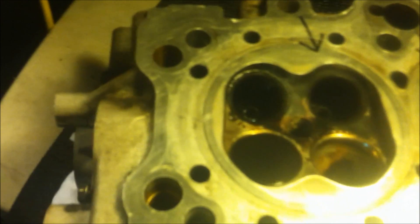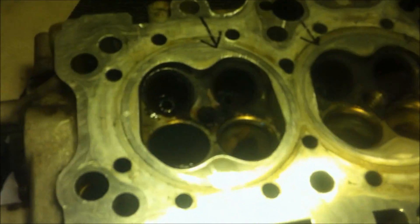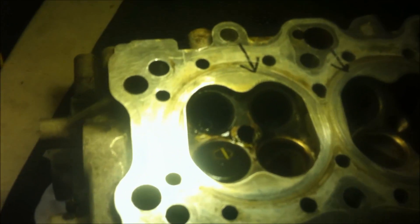It's that simple - you don't have to take it to a machine shop. You can do it at home with a vacuum hose and a drill. I usually used to use the other method but I like to use a drill now - it's faster and works more efficiently, but you can use the other method if you want. That's how you fix your own valves, your valve seats, leaking valve seats, with a simple little tool like that. Go out there and handle it - that simple.